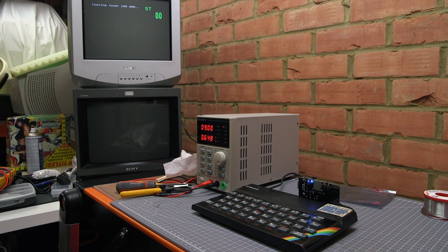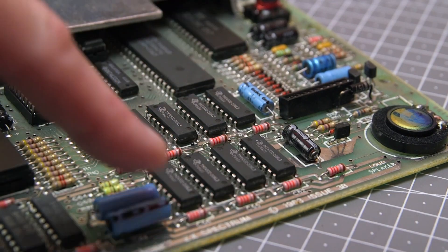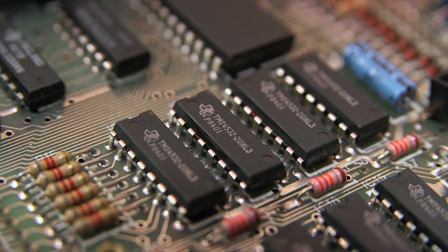With the smart card connected and a switch set on the back, it boots into the diagnostic ROM and starts running a memory test. Firstly it checks the lower 16k of RAM and this passes okay. It then moves on to test the upper 32k of RAM and there's a bit of a problem — it suggests IC21 is suspect. In the visual test menu, filling the RAM with all zeros should show blue pixels in the grid, but we've got some white pixels showing some RAM locations are reading back a one. Each RAM chip stores one bit in the 8-bit word, and IC21 is our suspect chip. I've ordered some replacement RAM but in the meantime I can get on with some other jobs.